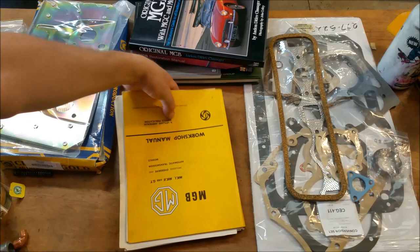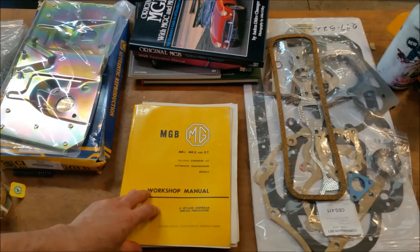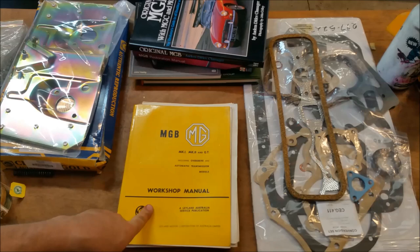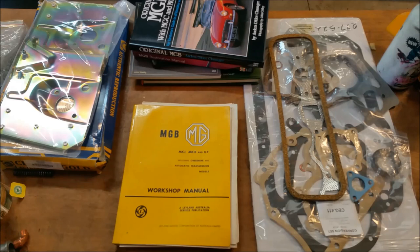And of course the shop manual — my brother bought it for his first MGB, which was my first car at 18 years old. I need to look in this because the heavy oil leak I thought was the rear main is actually the front gearbox gasket — it's not the input shaft seal, it's the gasket. I want to make sure when I take that off the whole gearbox isn't going to fall in my face, so I want to do that in the car. Lots of information available for them. MGB's can be thirty thousand dollars for an immaculate concours car right down to six or seven thousand for a fixer-upper. They're really really affordable and lovely and simple to work on — I can't recommend these cars enough.